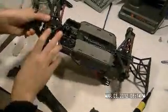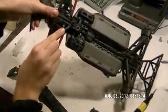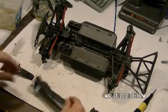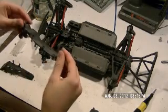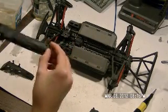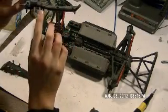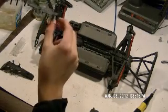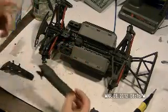This is what happens when you over-tighten your screw heads — they get stuck and you can't take them out, and you need to drill them off. Especially for this panel, it's always a good idea to just leave the screws inside it and not actually take them out once you remove the panel. As you can see, there are different length screws which go in different places, so just remember where they go.